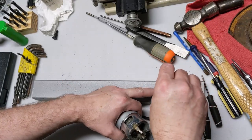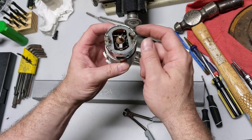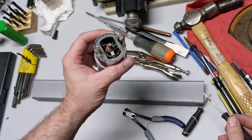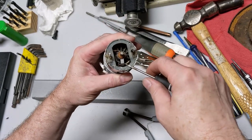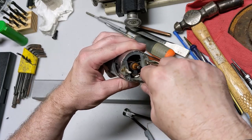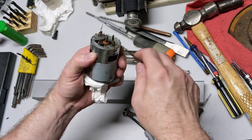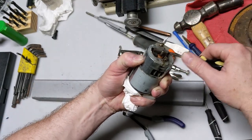I'll tap that back out flat before we go back. I've marked which side had the black wire so they know the polarity. Unfortunately, they just don't make these motors to be truly repairable — kind of a shame. Even some of these parts are available but they cost more than they should. Let's rock this back and forth just a little bit.